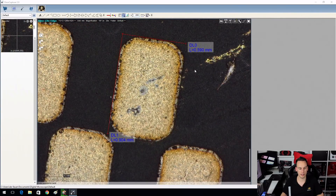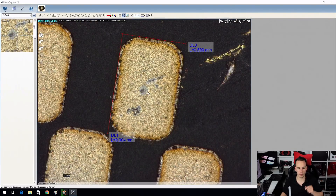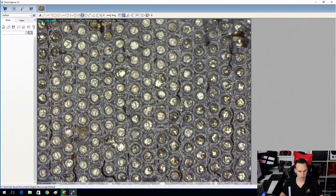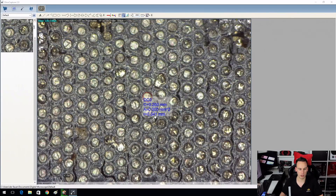The pad measures roughly 0.6 by 0.9 millimeters, which is really not much. In the middle you can see one of the contact spots — this is what you typically see after a CPU has been used in a socket. On a CPU that's been inserted more often, like a 7700K I checked before, the impact is much deeper and sometimes even a little blackish, likely due to the high current flowing through that point. Flipping the chip, we can measure the solder bump diameter: a radius of 0.04mm equals 0.08mm in diameter — extremely small. Imagine thousands of those connecting the die to the package.